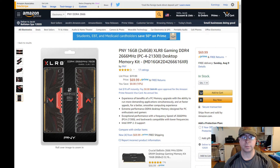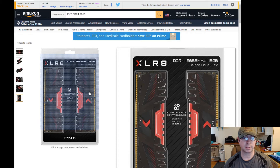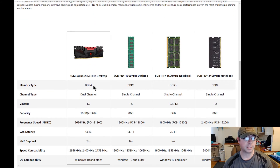I chose to get her a kit of two sticks of eight gigabytes of RAM each — this XLR8 DDR4-2666 MHz 16 gigabyte kit. It's good enough to run her games as well as her web browser, which streams a bunch of videos for music. Looking at the specifications: it's DDR4, dual channel, 1.2 voltage, 16 gigabytes capacity, takes up two DIMM slots on the motherboard, runs at 2666 MHz, with a latency of CL16, and is speed compatible for lower speeds if needed. This one was fine because her board was already operating at 2666, so it wasn't really a concern. If you want to learn more about dual channel versus single channel RAM, I have another video linked above.